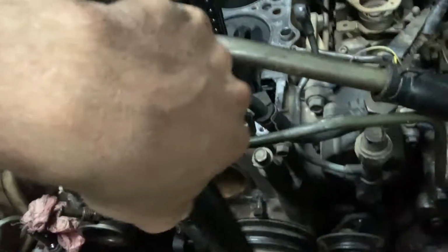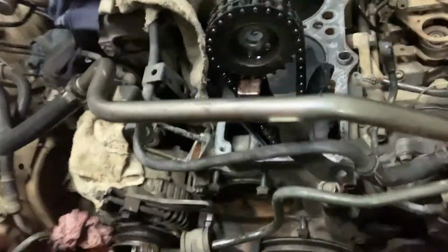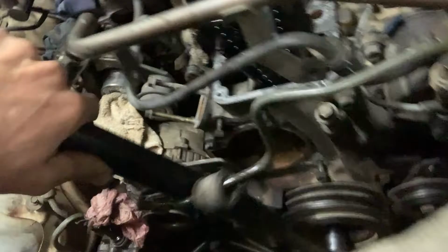So what I did was, I basically locked the brake pedal with this pipe, put it into fifth, and took my F-off come loose bar. Very stoked on that. This F-off thing is basically a ratchet that I shoved into this pipe, and then put onto the crank pulley, and then you just loosen it. It sounds like it doesn't want to come off, but it will.